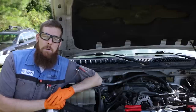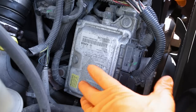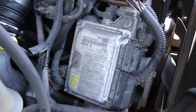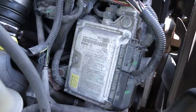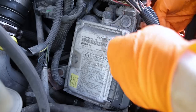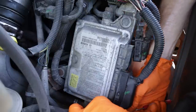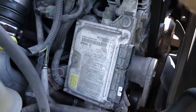With that said, let's go ahead and get started removing the fuel injection control module. First and foremost, disconnect both of your battery's negative cables. We went ahead and removed the charge pipe between the turbo inlet and the air box, removed the upper lid of the air box and the air filter — four number-three Phillips head screws hold the air box lid on, and two 8-millimeter worm gear clamps hold the intake pipe between the air box and the turbo inlet. Once that's out of your way, remove the connectors — just grab and pull up. Once it pops or clicks, you can pull it down — same for the other connector. Push that tab down until it clicks, then wiggle it back off the fuel injection control module.